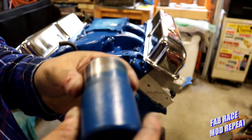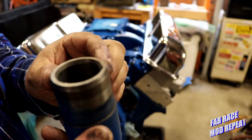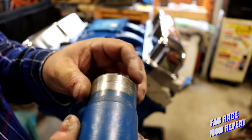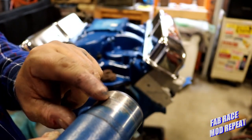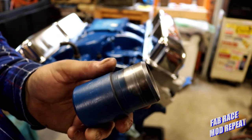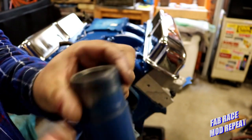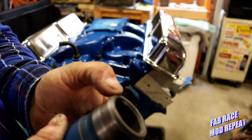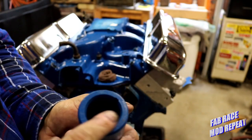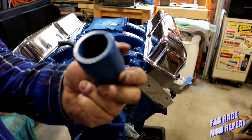That's all I'm going to say about these sleeves. They are cast iron and you can break them like anything else made out of cast iron, but the reason they're made out of cast iron is they're durable. And there's what rubber can do to hard metal over enough time. The chamfers are there to help you — this chamfer is to help it go through the seal, this chamfer is just there to help it slide, and same with the front chamfer. That gives it a nice sealing surface for your balancer to set against.